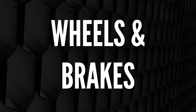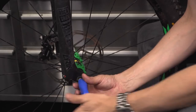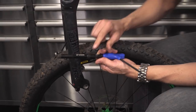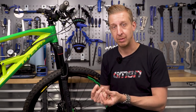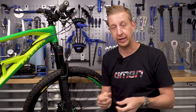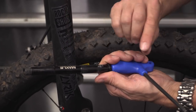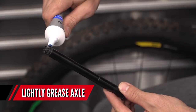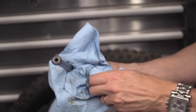The wheels have to deal with a terrific amount of load and abuse from braking, acceleration, and hitting the ground. When you remove the wheels from the frame, check the wheel axles themselves. Depending on whether your bike has a maxle or quick-release style axle, make sure that device is clean. If it has a lever, check the cam is lubricated and works correctly, and make sure it's adjusted properly when you reinstall it. Check the axles themselves — if they're dry or corroded, they can creep within the hub shell. Put a tiny bit of grease on them to help them slide into place, but don't use too much as excess grease draws dirt and grime, which can lead to further creaking.